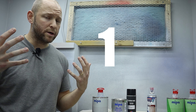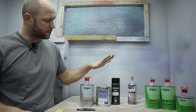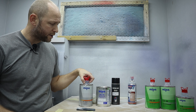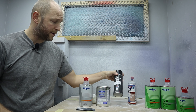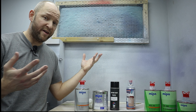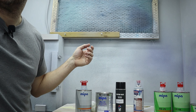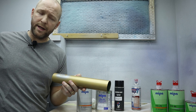These paints are either one-component (1K) or two-component (2K). A 1K paint usually consists of a single can or aerosol — if you use a can you usually have to dilute it with a reducer, while the aerosol is pre-mixed and ready to go. A 1K paint dries very fast as the solvents vaporize, usually within an hour. What's left is the dry paint, and if you add reducer to it, it will simply dissolve the paint again.